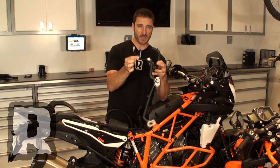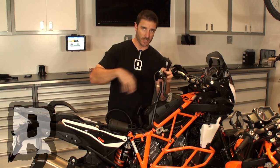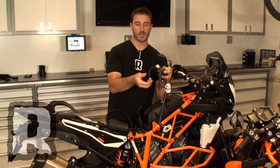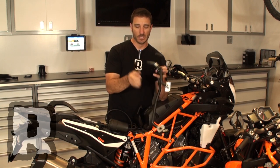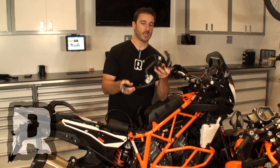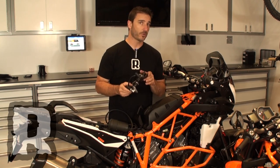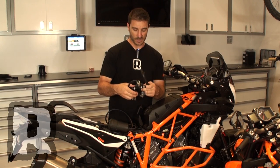When you unplug these, you'll throw an FI light on the dash because the stock ECU on a KTM monitors the entire system. When something's unplugged, it'll throw an FI light that blinks and it'll annoy you. So when we mention the SAS dongle, that's this plug right here. What it does is when you unplug the SAS valve, you plug in our little dongle, and it fools the ECU — the computer — into thinking that something's still there. You'll still get a warning light for other important things, but it will fool the computer into thinking the SAS is still there and everything else will work just fine.